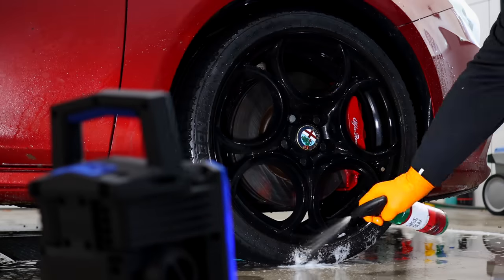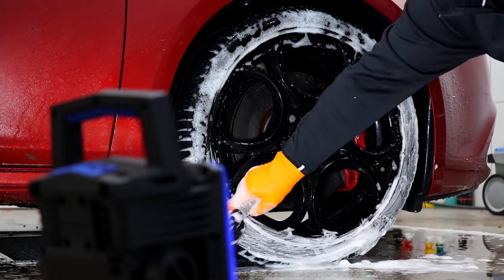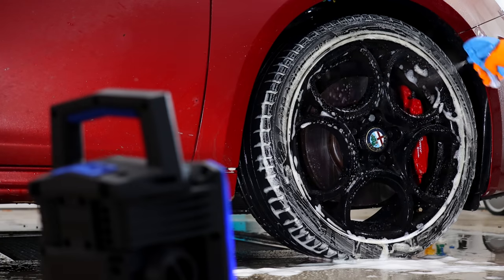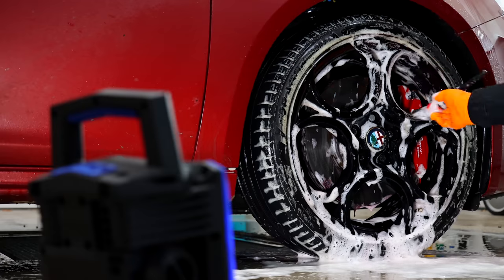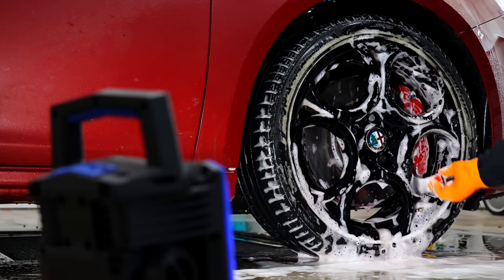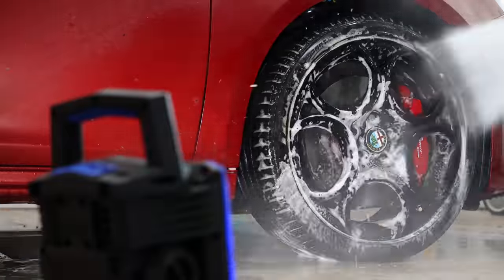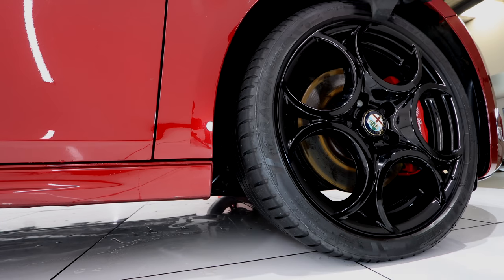And you'll see this on this car wheel. My advice, if I was to do it again, is to make sure you wipe any residue immediately off the rims, or better still, apply some masking tape over the outer rim edge to avoid this. I would also advise, if you can, to take the wheels off the car to apply Blackout, or at least raise the wheels and rotate them to get better access to the tyres and a more even, uniform finish.